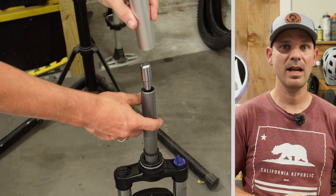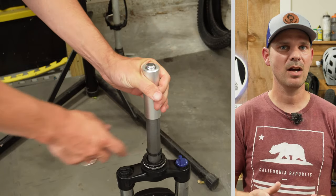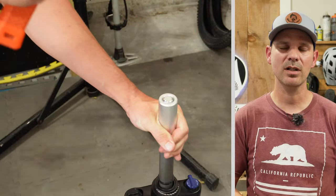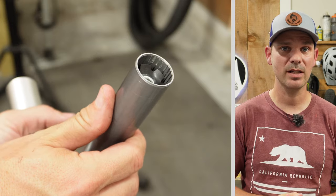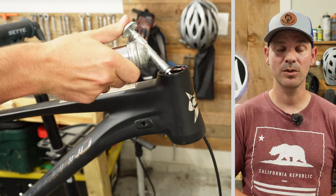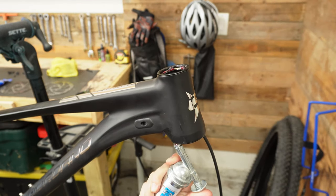So I went ahead and I put my star nut installer on and hammered that sucker down, got it down to the proper depth. This is something that if you guys aren't familiar with how this works, I'll put a video right here and down in the description on how to install a star nut, with links to a star nut installer. If you don't feel comfortable doing this yourself, definitely take it to your local bike shop and they'll do it for you.